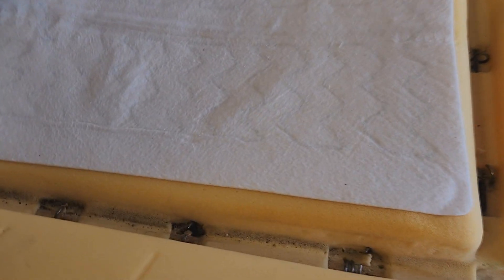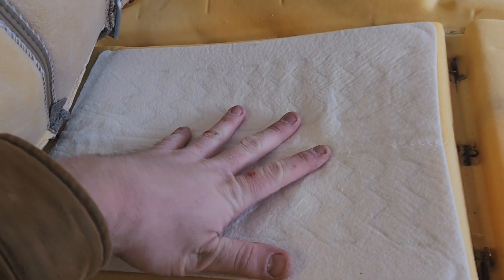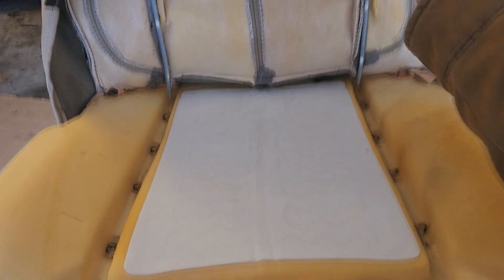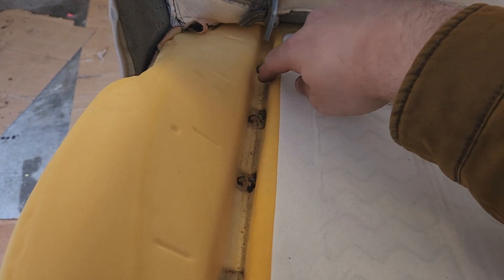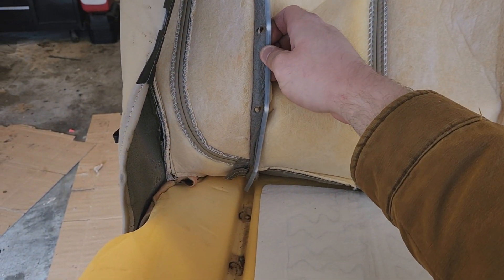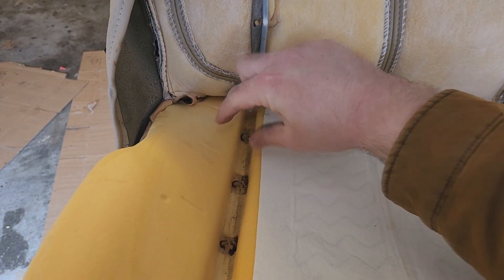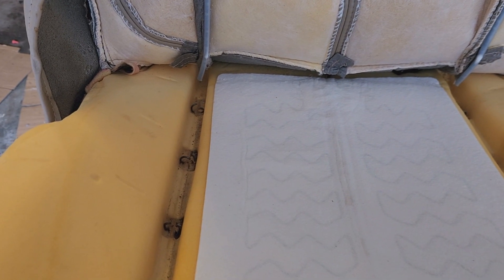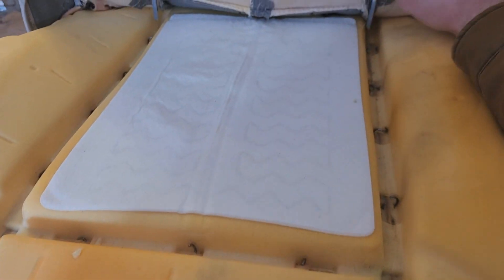All of the metal clips have been disconnected. It looks like this is the lower heated seat element — very fun. There are four metal retaining clips on each of the long sides and three in the front. I'm leaving them all in place because I'm going to be reusing them. It's very important so the seat doesn't slide around on top when you're on it. When I lay the new seat fabric down I'm just going to poke these through that little fabric section, use my pliers to crimp them closed, and turn the seam towards the bottom. This is a tedious process but it is easy.